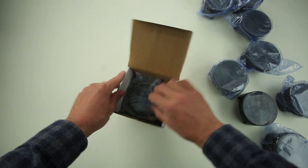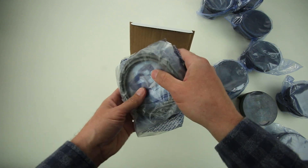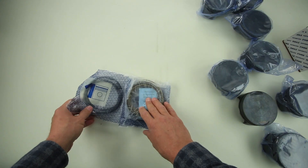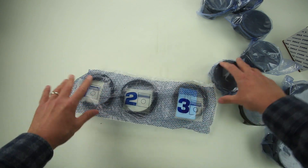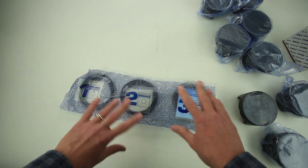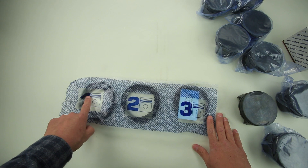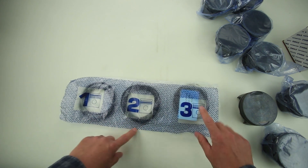The last part of the equation is the ring pack. Because this is a drop-in piston kit designed to go right in where the factory pistons came out, these are OE-style piston rings. When you take them out of the box, make sure you don't mix them up. Mahle has you covered: number one is the top piston ring, section two is the middle ring, and section three is the oil ring.